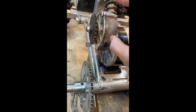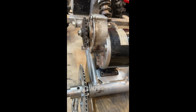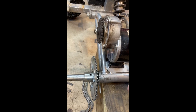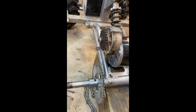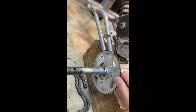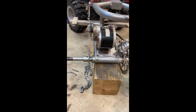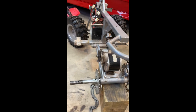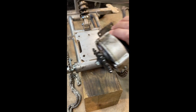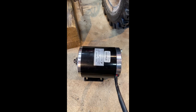The stock motor is tiny with a gear reduction drive that gears down the motor's output RPM, then there's a big sprocket on the end. I was previously overvolting this motor with a 36 volt system - it's designed for 24 volts - which gave more speed, and I geared it down with a larger 54 tooth sprocket for better torque. But my son is an advanced rider now and has outgrown it, so it's time to upgrade.